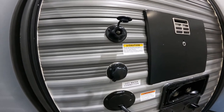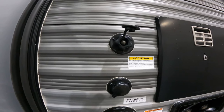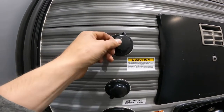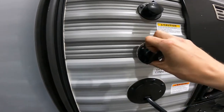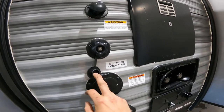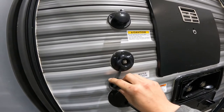There are sprayers inside your tank, so after you empty your sewage you can plug a pressurized hose in and it'll spray and clean your tank out for you. Just below that is your city water connection — this is where you would connect the pressurized hose, either coming from a house or at a campground.